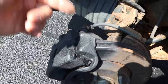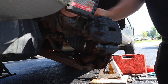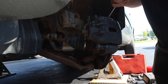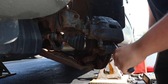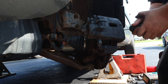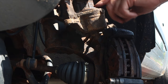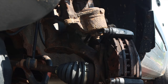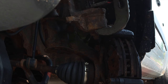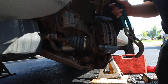I'm gonna take the caliper off and take the bracket off, then we'll get into it. The first thing we're gonna do is take off the caliper itself from the bracket. We should be able to get that caliper right off — it's pretty crusty, but that's normal for these elements. Before we go any further, we're gonna make sure that our piston can be collapsed, so we know we don't have a seized piston. The piston's going in really good, pretty much all the way in — so we know that's good.